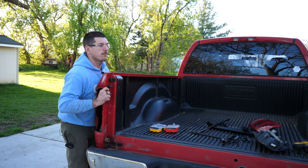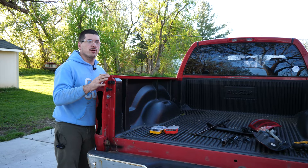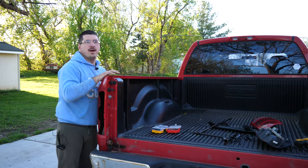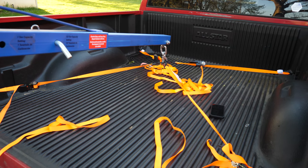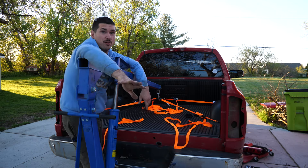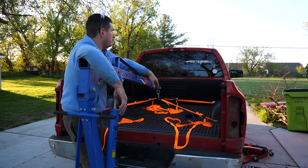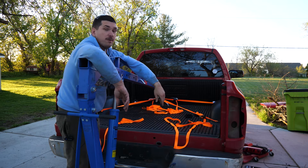We appear to be disconnected. One last quick check just because I'm paranoid, and then I'm probably going to use the engine crane since there's only two of us — it's going to be pretty difficult getting this off and maneuvering it with just two guys. I couldn't find my chains, so we just used some ratchet straps and strapped it to the four corners. Honestly it's really not that heavy — if we had a third or fourth person we could just carry it away. We're going to take this lift straight up and hopefully jockey it past the bumper, since I didn't remove that yet, and then find a way to get it to the steel yard.